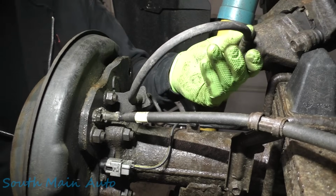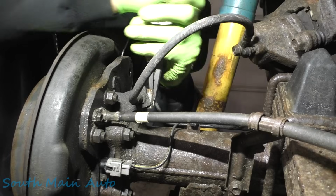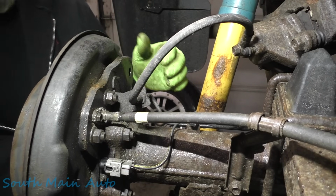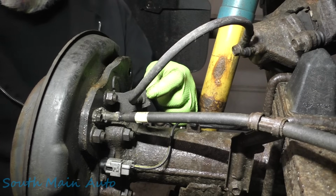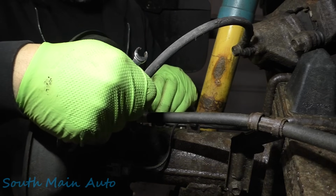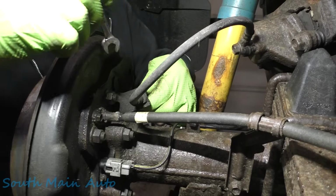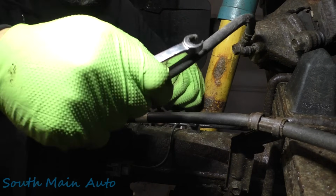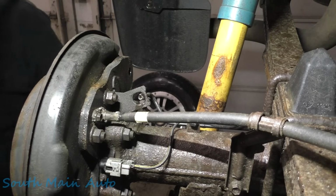And now we can finish taking off our brake line nut there. But we will also get the brake line clip off, which is that little fella right there. Okay. Drop it directly onto the floor, and finish unhooking our hose. It'd be nice if this was slotted, which if you don't want to screw on, just take your cutoff wheel and just notch this, because then you can pull it ahead a little bit and then just stick your line through it, you know what I'm saying? So finish unhooking that. We'll set the whole caliper aside. We'll go hang it somewhere off the hose, that's what we'll do.